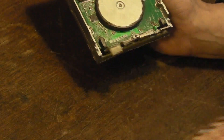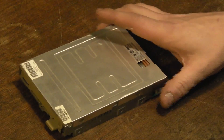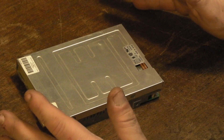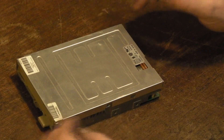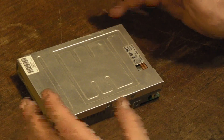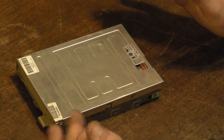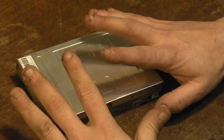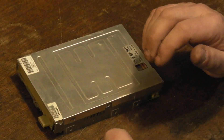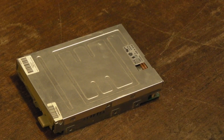Hopefully it was just literally a little bit of grease and giving the heads a quick clean. I was expecting to have to change those capacitors in there, but if they don't smell, generally speaking there's nothing wrong with them. Those capacitors usually fail by actually physically leaking on the board and causing all kinds of havoc. The best test I've found for them is that smell test - and they passed. So I'll just quickly pause the video, I'll get this mounted back in the computer, we'll get some disks out and we'll see if we've fixed it or not.